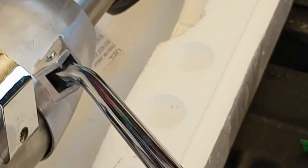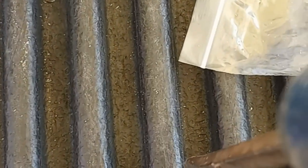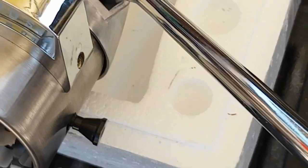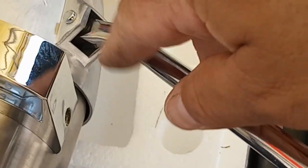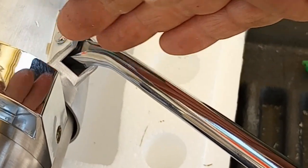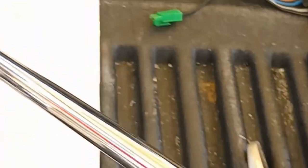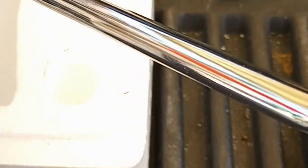So the easiest way for me to do that was I used a flathead screwdriver and I stabbed it in between one of the coils on that spring, and then kind of fed it in there sideways, and then pulled this out. And then this lever is beveled on one edge. You get it on the front side of that spring, and then tilt it back, and then line up your hole and put your spring. So don't forget the spring. That's what springs it back, obviously.